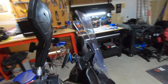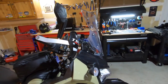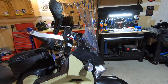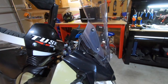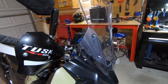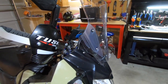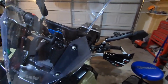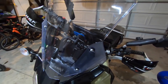The risers do change the angle of the windshield quite a bit. When I first saw that online I thought it looked kind of goofy but I actually like it — in person it looks pretty good. One thing to note: when I was taking my windshield off all the bolts were extremely loose. When I put them back on I just put them on hand tight — nothing crazy. There's a crack when you do that; they're on loose for a reason, so keep that in mind.